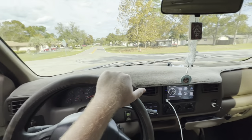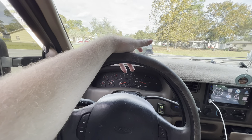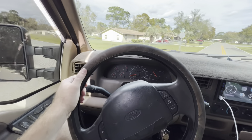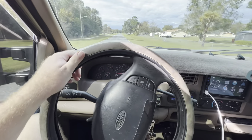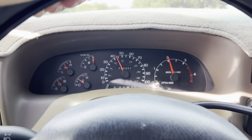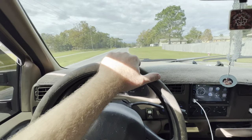I've got the 80-horse daily driver tune loaded up. I drove it this morning about 40 minutes away for a detail and got to see how this thing shifts — I think we fixed the problem. We're in second right now, going to third, and then into overdrive — shifted perfectly, not a single issue. Before it was stuttering going into overdrive, it would hesitate — something you could feel but it wasn't showing up on the RPMs at all, and the trans fluid looked perfectly fine.